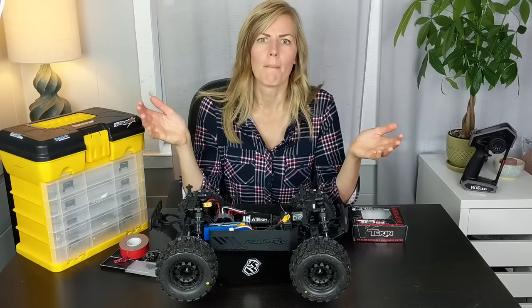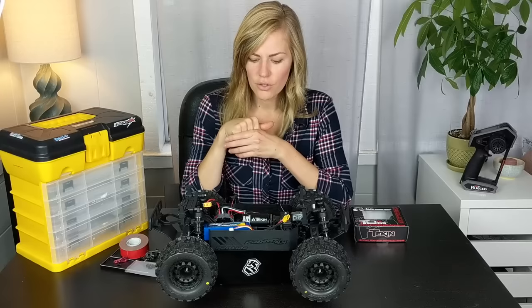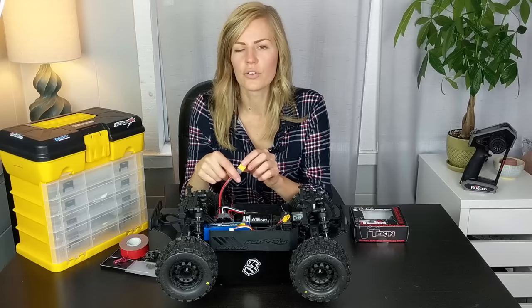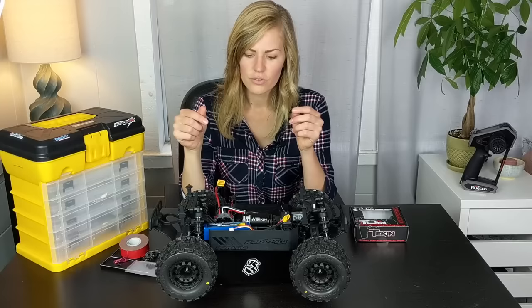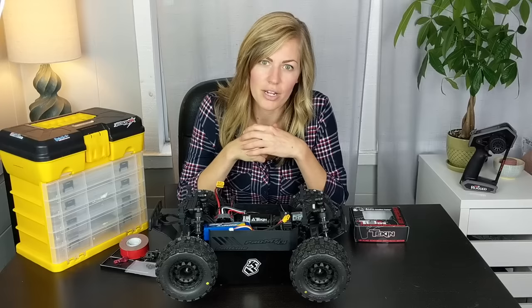So we got our motor soldered to the ESC. Unfortunately there was a camera error and it didn't capture much of the soldering — that's a bummer. I'm not that great at soldering anyway, so I'd encourage you to get really good before messing around with expensive electronics. There are 10 solder points total: three on the motor, five on the ESC, and two to whatever battery connector you're using. I'll put a link in the description to a video I watched before doing the soldering. Your local hobby shop can also help if you need assistance.